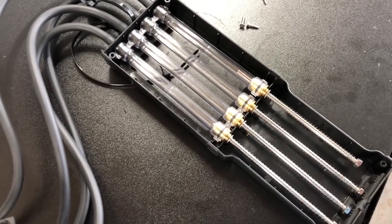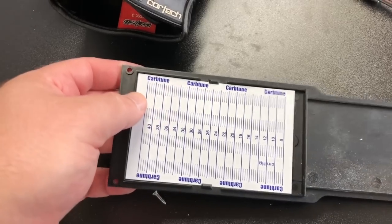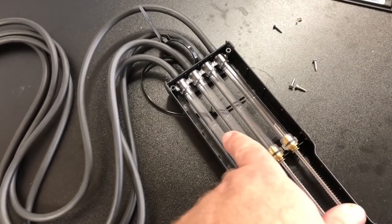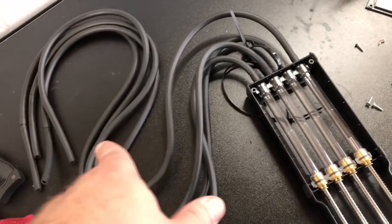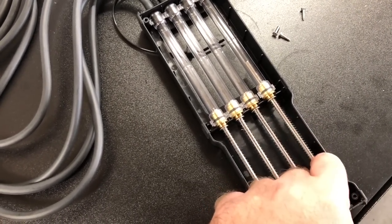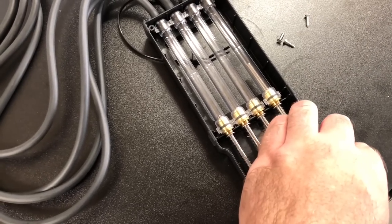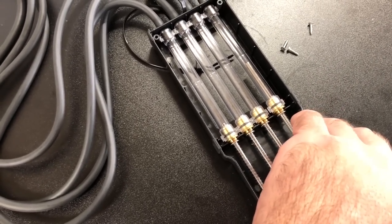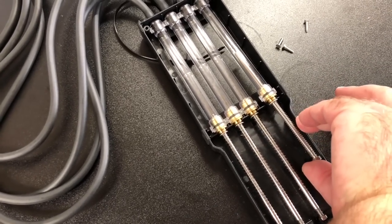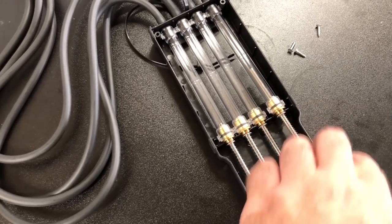You can see the tubes in there. There might be a bunch of dust on the little piece of paper — that's the gauge — just wipe that off. It's a very simple tool: four plastic tubes, and as the engine creates vacuum it sucks up the metal rods, which work against these very soft tension springs. The rods bounce up and down as vacuum is created. You can see this one is kind of sticky — as I let go it doesn't totally spring back — and that's because it's gunked up.